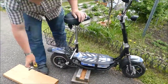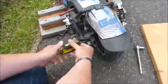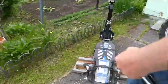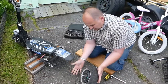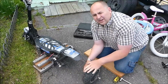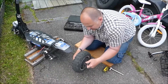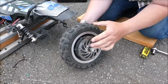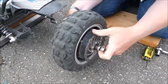Okay guys, the hub motor is out. Like I said, with hub motors it's pretty simple and straightforward — a couple of nuts, one cable and you're good to go. Like I mentioned before, when the grinding sound appeared during the trip I raised up the scooter, spun the wheel, and I didn't hear any grinding sound. Right now it spins with no sound at all. That's a geared hub motor — it has gear reduction inside, and a one-way bearing that spins freely in one direction and has tension from the gears in the other.